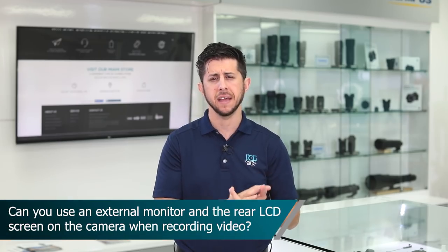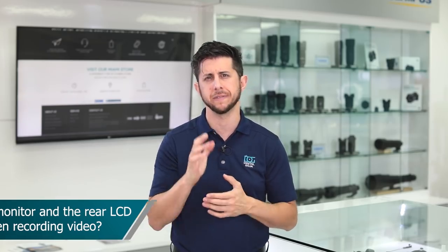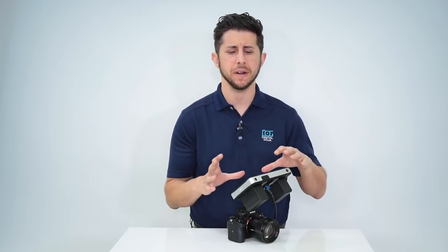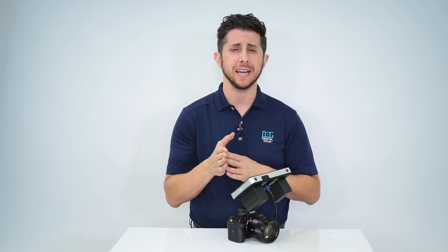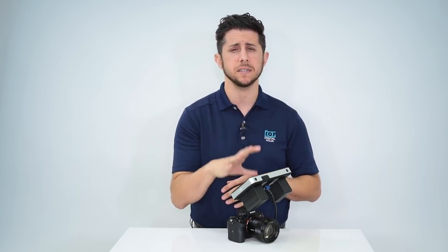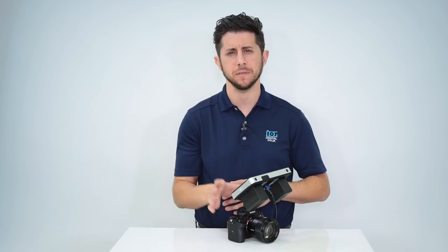It's really important to connect an external HDMI monitor to your camera when recording video. People want to know: can you use both the external HDMI monitor as well as the screen on the back of the camera to record video? I always recommend using an external monitor when recording, especially with the a7 III. When you first get your camera, go into your camera setup menu, into tab three of seven, go to your HDMI info display, turn that off — this will allow you to get a clean signal to your external monitor and have the info displayed on the rear LCD.